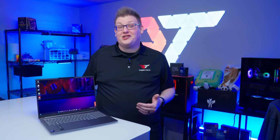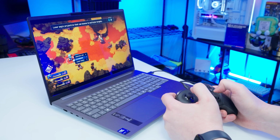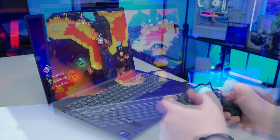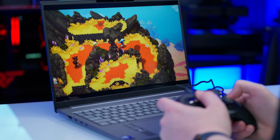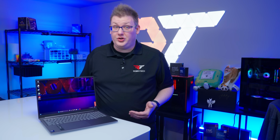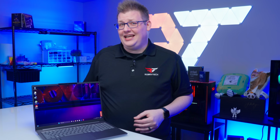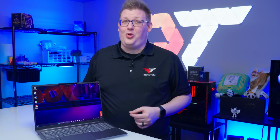These are paired with the Intel Arc 140T integrated GPU with Intel Arc Alchemist Xe graphics cores, which is a mouthful to say. Now, in case you're worried about graphics performance in gaming, remember, these are similar cores to those driving gaming handhelds like the MSI Claw, but these cores have learned some new tricks. Intel updated the Arc 140T with the new XMX engine to assist in AI workloads, doubled the ray tracing capabilities, doubled the L2 cache, and thanks to pairing with the 285H's CPU cores, it has more headroom for performance. In other words, this isn't the Intel integrated graphics of ye olden days.